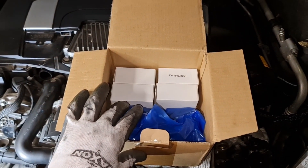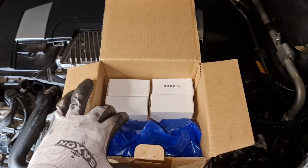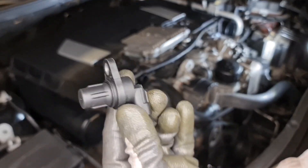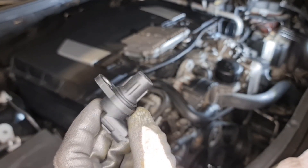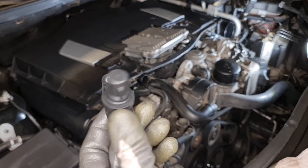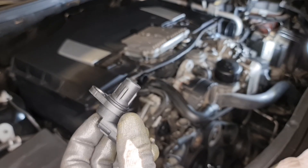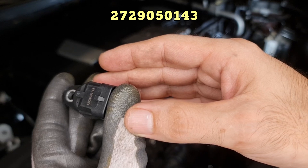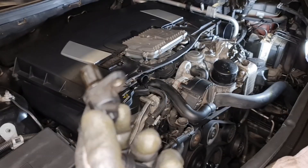This kit can be bought from eBay or any other store. I bought this complete set for 170 Australian dollars. There is also one benefit in replacing the CPS: you can see the rubber seals, which leak over time. These new ones are brand new and hopefully will last and avoid oil leaks all over the engine. The part number for these sensors is 2729050143.